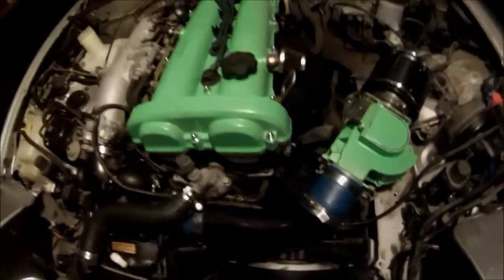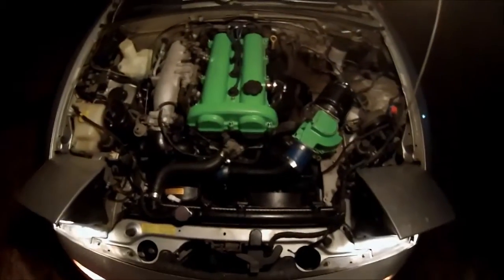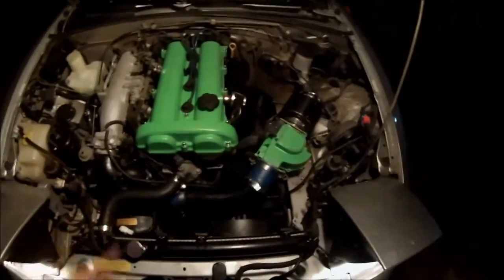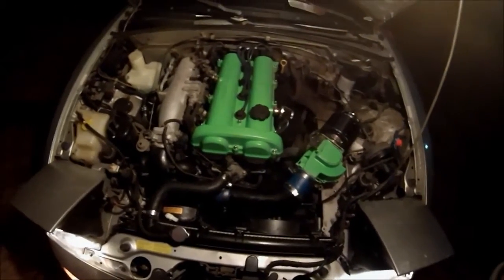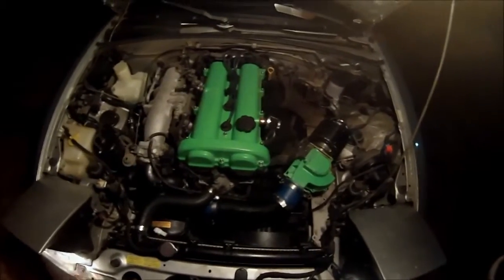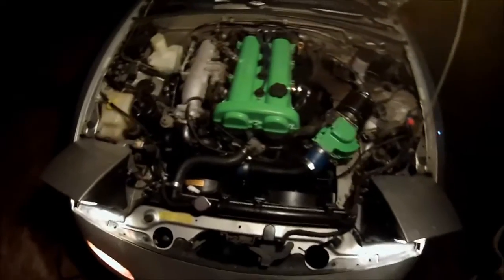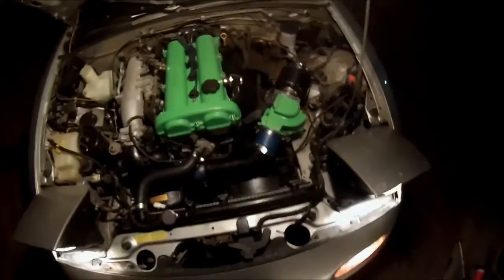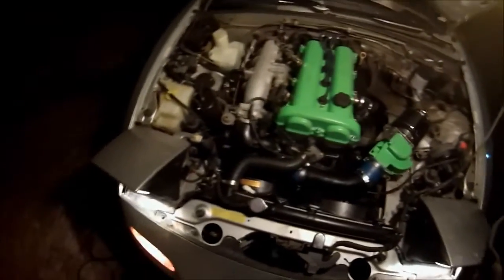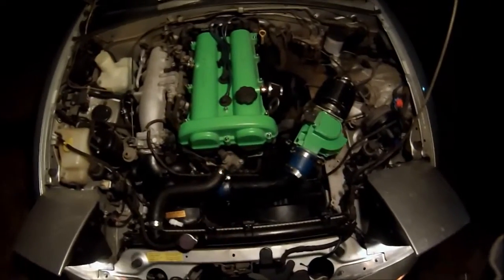I didn't loop those lines together. I figured I'd take it out for a spin before I looped them together, but it works pretty good. I'm still probably going to loop those because I think it might make a difference, but it feels like pretty much a factory Honda's non-power steering rack and pinion, so I'm pretty pleased with it. So I hope this video helps somebody. It definitely did work. I will be selling all this stuff, so if you're a subscriber and you're close to me, it's for sale. But I strongly suggest you do this mod.